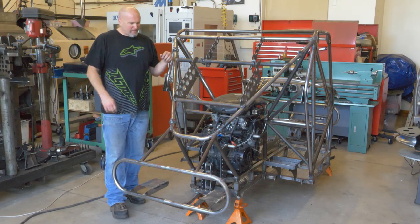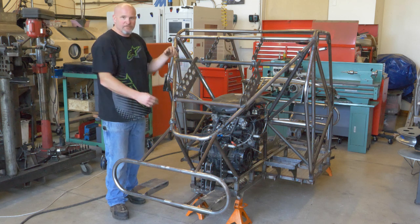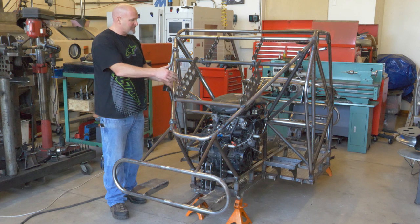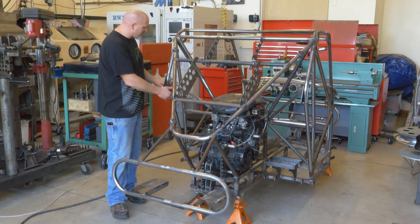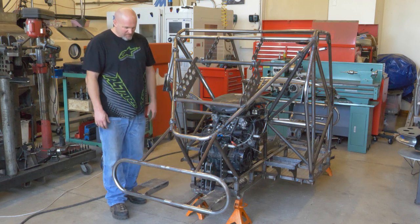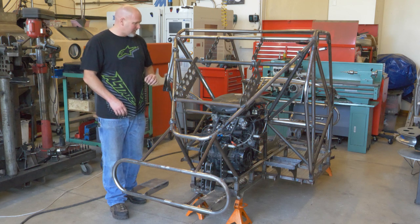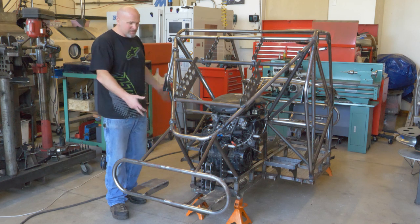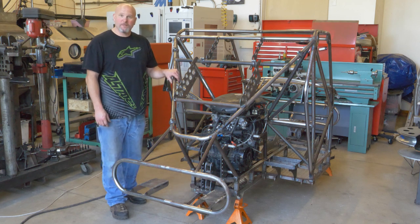Alright guys, I got the frame cut, flanges welded in to bolt it back together so that this piece of the frame can be removed and put the engine in, which we've accomplished. I got the floor pans on, I got the seat mounts welded in. I think we're going to end this video right here, and in the next video I'll work really hard on getting the rest of it all put together, the suspension, and get this thing to the point that I can drive it.